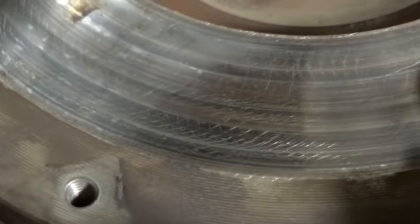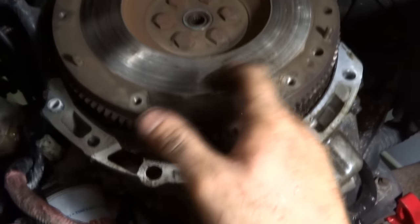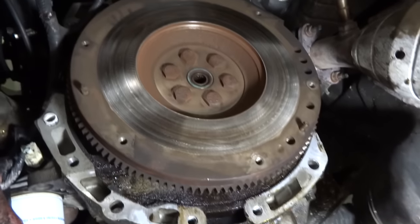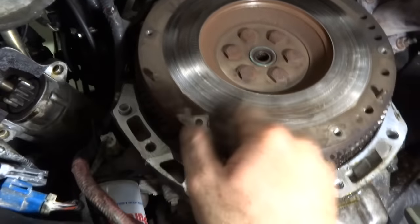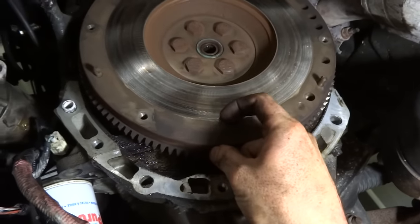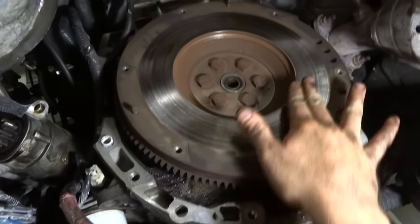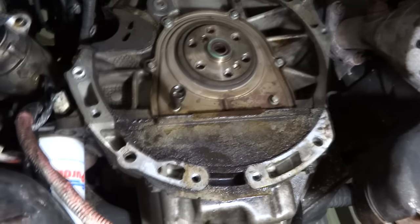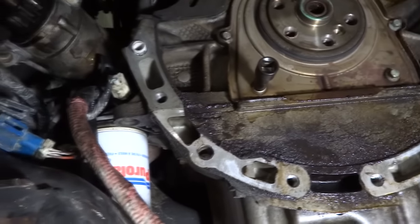Believe it or not, this clutch did pretty well for having 211,000 miles. There are also some other chipped pieces — hopefully it didn't damage the flywheel; if it did I'll have to get it resurfaced. Right here it looks like you got a little bit of scraping. But the spring only touched it just a little bit and those are just surface scratches — I can't even feel it with my fingernail. I'm going to go ahead and use this flywheel without getting it resurfaced. I've been using flywheels without resurfacing for years — unless it's a race application I don't bother unless there are nasty grooves. There's not even a lip on it. The flywheel bolt size is 18 millimeter.